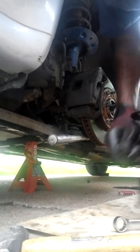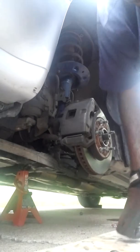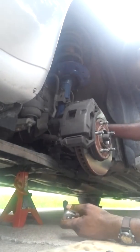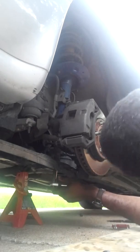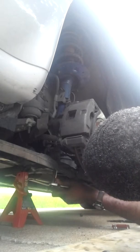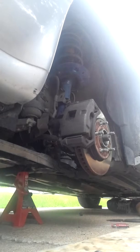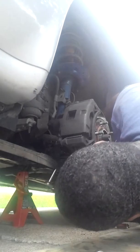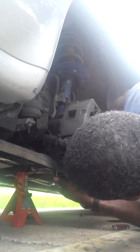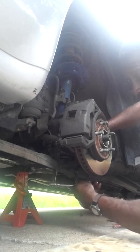I got that broke loose. I took my gloves off. Let me see if I can show you this last bolt I need to disconnect — it's a stabilizer. Size 13. I need to use my pliers on top of it. It does have a flat nut on top of it. One of the best things to use for loosening bolts is a chemical called PB Blaster — works way better than WD-40.